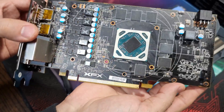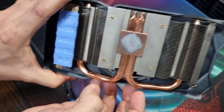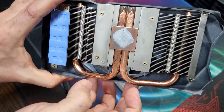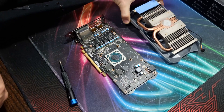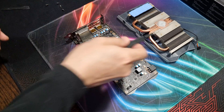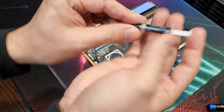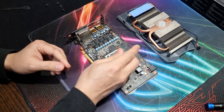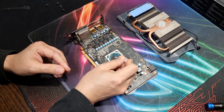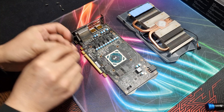We've got it all cleaned up as it should be. I used to have liquid metal — Thermal Grizzly Conductonaut — but that was just for testing. That stain doesn't affect cooling performance at all. So we'll start with Cooler Master Master Gel Pro to set the baseline. We'll just apply a little bit on there — that's enough — and go ahead and spread it.